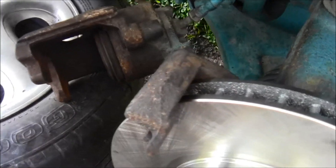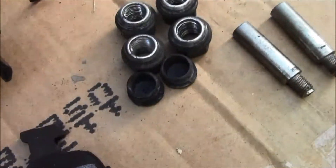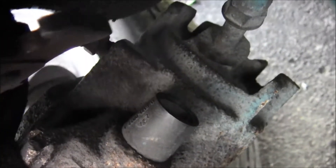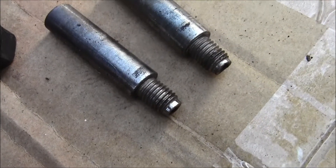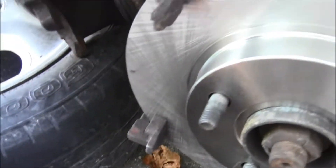There are two seven millimeter Allen keys. First there are little dust caps you have to pry off with a screwdriver — you take that cap off, it's just a little cap that goes inside here. You push it off with a screwdriver. Then you put a seven millimeter Allen key on there. Don't forget to take this little metal piece off first — that's the first thing you want to do.